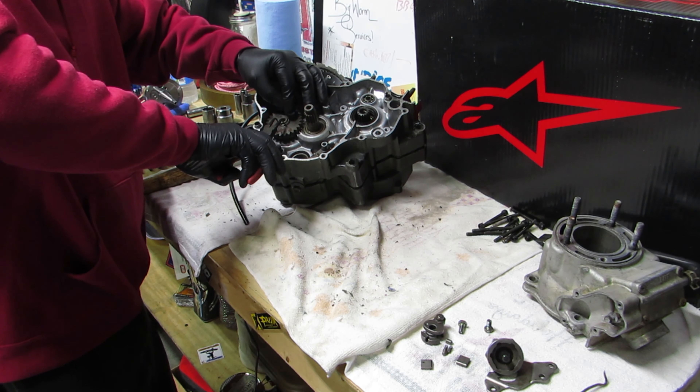Like I said, I'll go ahead and re-grease all your bearings and stuff. I just rebuilt this motor and the crank was wrong, so it hasn't been started, haven't put oil in it. Make sure you re-grease everything, make sure all your fittings are good for your water ports, and clean up all the excess block sealer. Let's go ahead and see if we can get this crank out and keep going. There again goes to show you - when you use an assembly lube, things come apart extremely easy.